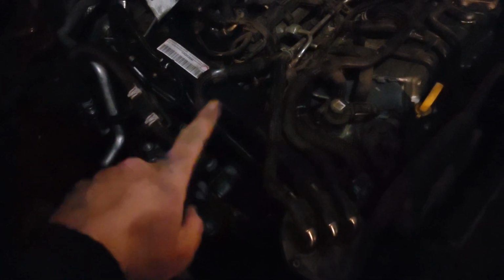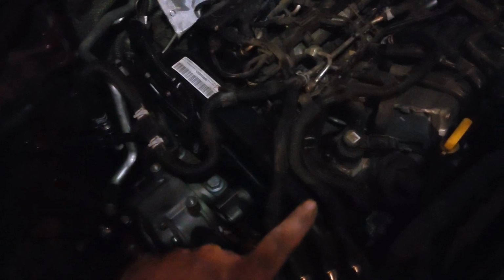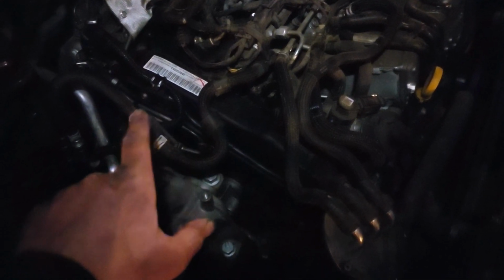All right, you hooligans. As you can see, we didn't make it. But let me show you where we're at. It's a little dark, but you can see motor mount's in, timing belt is done. I had to do that 3 times in order to get the teeth right between those 2 pulleys. That was fun. But the cam timing versus the high pressure fuel pump and the crank pulley, that's all got to be within certain specification, and if you're off by a tooth, you hose the whole thing up. So I'd rather do it 3 times and get it right than hose it all up.